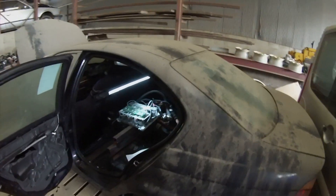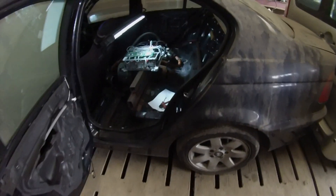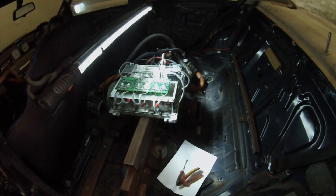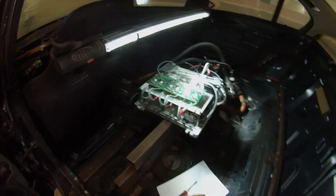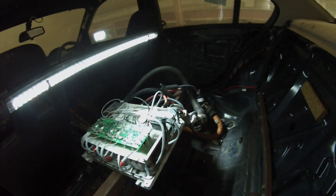In true barn find fashion, we've got a nice dust cover on her. She's been languishing in Dave's shed. We've got our trusty high voltage danger sticker, and in the back you'll see we have installed our modified Ansaldo inverter in a very haphazard fashion. This now has the Paul Holmes logic and control board on it, with the high voltage wiring and encoder wired up.